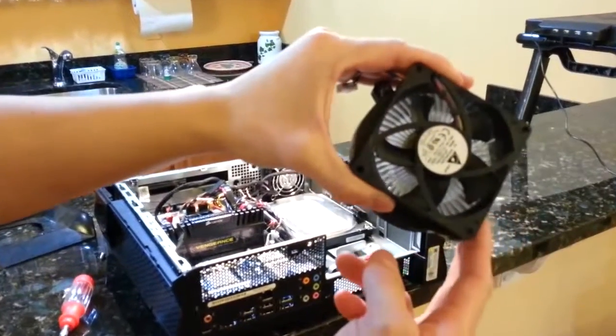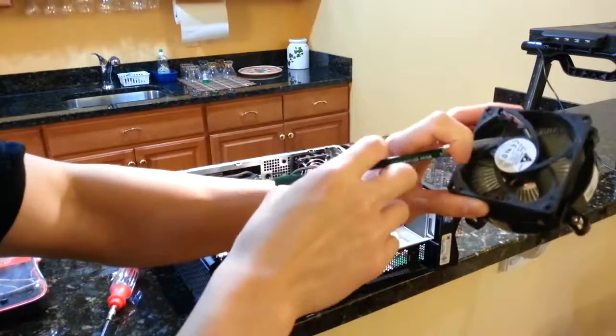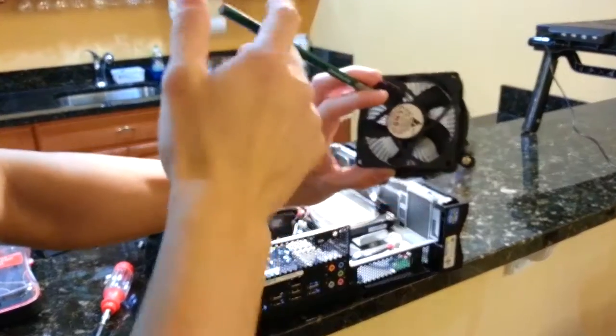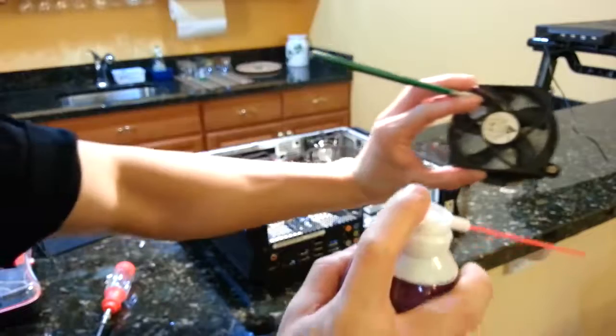I had this recording at 1080p. If you look closely enough, you can see the dust particles accumulating on the blades. So again, I'm going to lock this in place with a pencil to disallow for fan rotation. I'm going to blow away from the case.